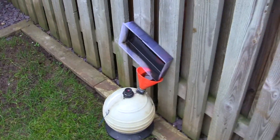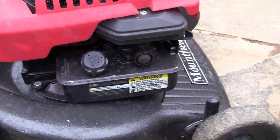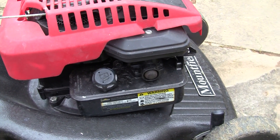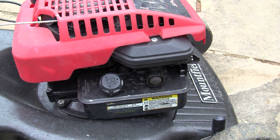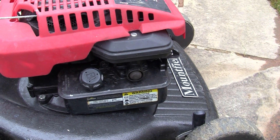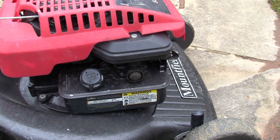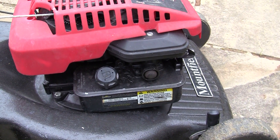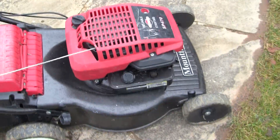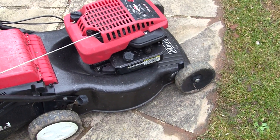Hi, welcome back to Repairing Lawnmowers for Profit. In this video I'm going to test something I've wanted to try for a while with these little Briggs carbs. I've heard on some videos and forums that you can run these with two diaphragms. I'm going to try this because a lot of people buying cheap diaphragms and gaskets off eBay find they're not working because they're too thin. I suggest buying a genuine Briggs and Stratton gasket set, which I'll link in the description.